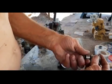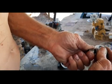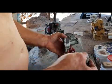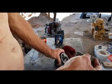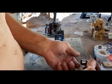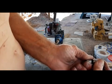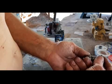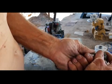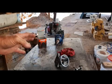It goes in by that hole, and it pulls this apart, and then this contacts, the light comes on. So immediately if the light comes on, there's either no oil in it, because it doesn't press that way, or the light comes on because the filter is blocked and gone, and it pulls this valve this way. So this valve mustn't come this way, they must be like that. As soon as this one comes this way, the light will come on. So it's either very dirty oil or a blocked filter.